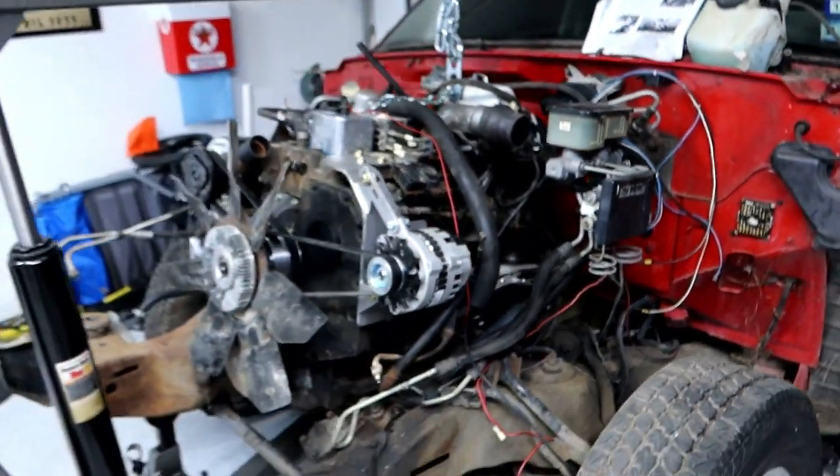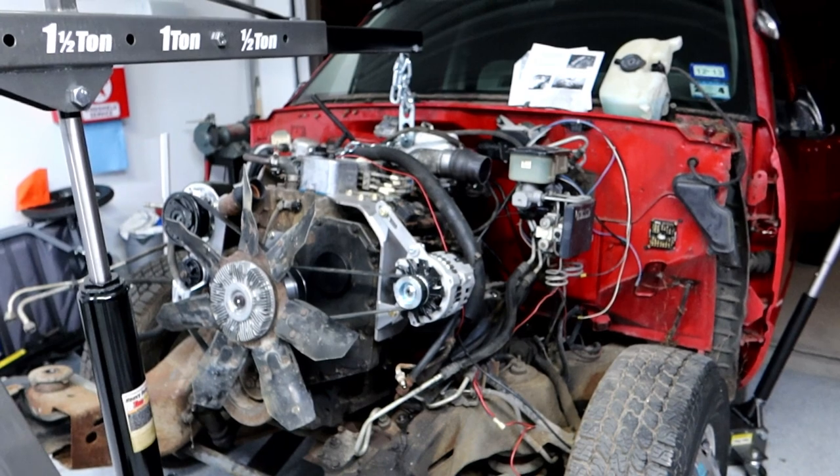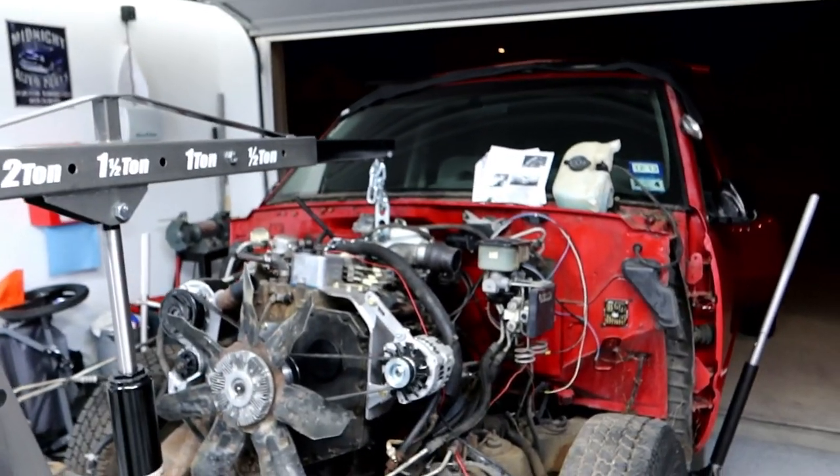It's starting to look like a diesel truck again, so we're definitely getting there. I'm probably going to have to take everything back out. I have some metal shears that I might be able to cut the transmission tunnel with, but they leave a gap of about half an inch of metal as they cut. They don't cut deep and they don't throw sparks like a cutoff wheel, so I might use those. I might have to put filler metal in anyway depending on how high I go, and how high I'll have to go is really the big question right now.